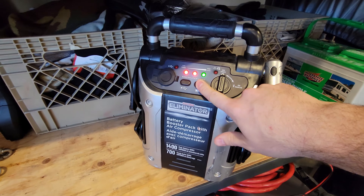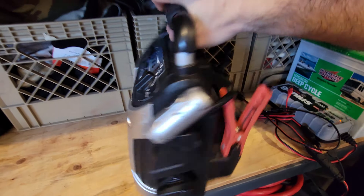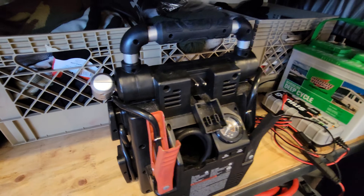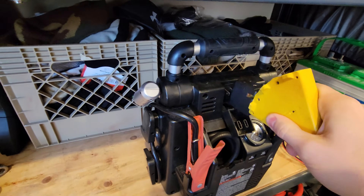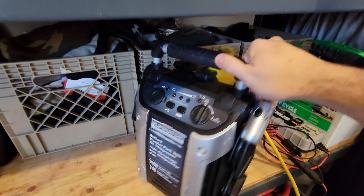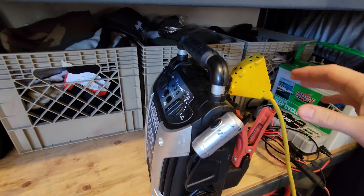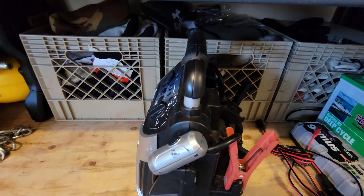The battery is showing fully charged because I charged it, but I want to show you what's happening here. On the back is an AC charging outlet, and what you typically do to recharge it is plug in an extension cord. This one I know is good — I just tested it. But basically what's happening is I'm not getting any lights. Whatever is in here — the 110 AC to 12 volt DC trickle charger — is not working anymore.